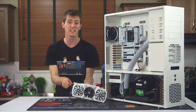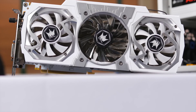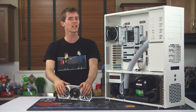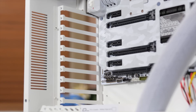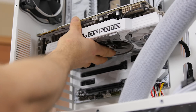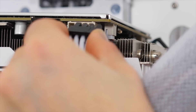The video card was yet another super obvious choice. What video card is white enough to go with our white-themed build? The GTX 980 Hall of Fame from Galax. The only real question was: liquid cool it or leave the stock air cooler on it? That question was answered for me when the only company that makes a block for it didn't have it ready in time for filming and didn't reply to my emails. So there you go. This case includes no PCI slot covers, although they can be purchased separately. The process is as simple as lining up the card over the top PCIe x16 slot, firmly pushing it into place, and installing two of the included fine-threaded screws. Finally, plug in your two PCIe 8-pin power connectors from before.